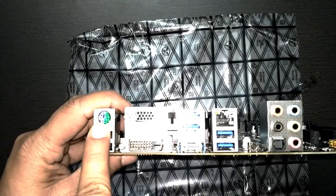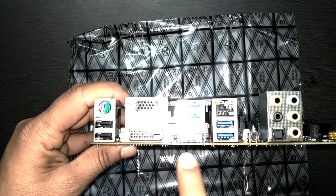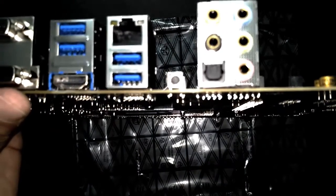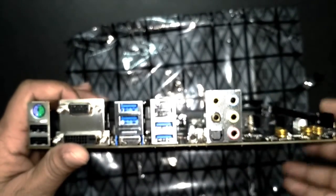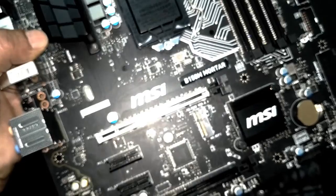There's a PS/2 port where you can attach a mouse or keyboard. USB ports include USB 3.1. I can also see a small button which is the CMOS clear button — pressing it resets your BIOS password. The integrated audio is 7.1 surround sound, which was one reason I ordered this motherboard. There are also six USB 3.0 ports total across the front and back panels, plus four USB 2.0 ports.